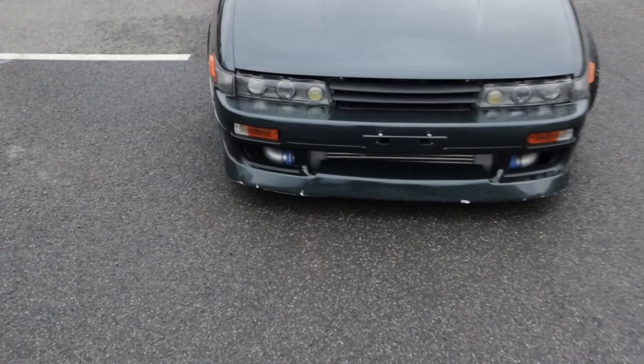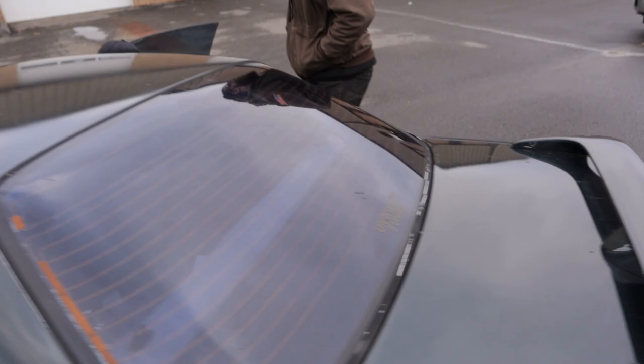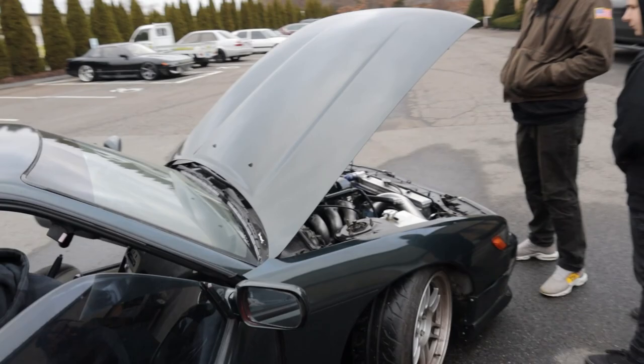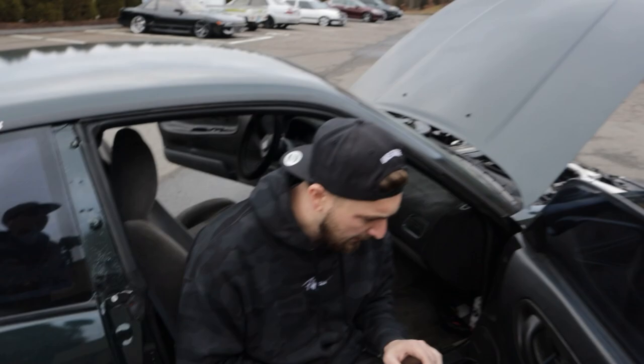It's not even chirping — what is happening? Maybe it's map sensor related. Have you plugged into it yet? No, I have no USB cable. Let's plug into it. We did not make it very far — we literally just died in front of Jimmy's shop. Once we were able to plug into the ECU it was very clear the map wasn't the greatest, so there was just a bunch of fuel in there. We took out some fuel and the thing's already idling way more responsive than before.